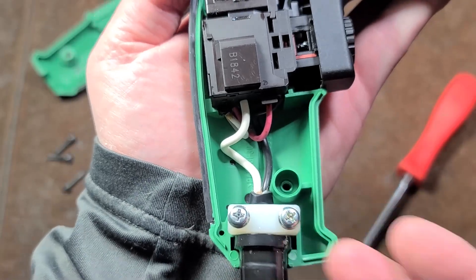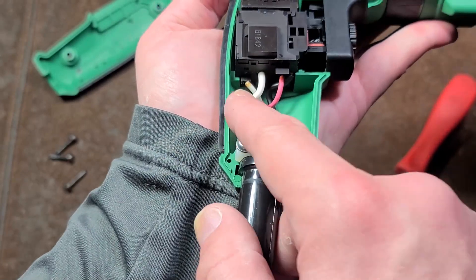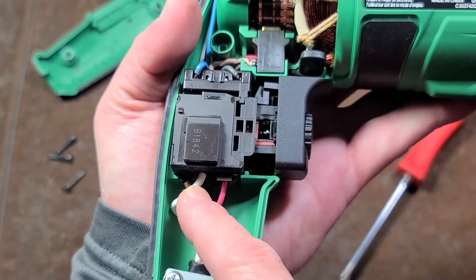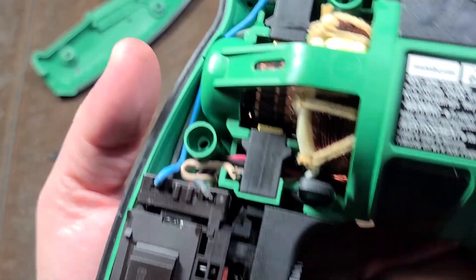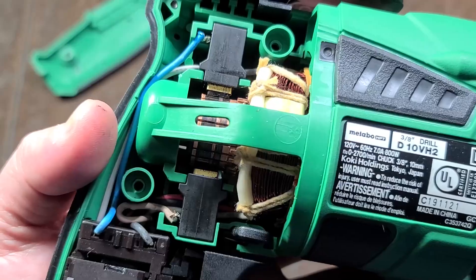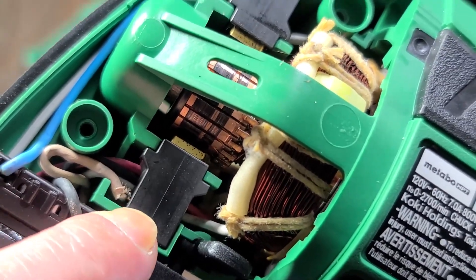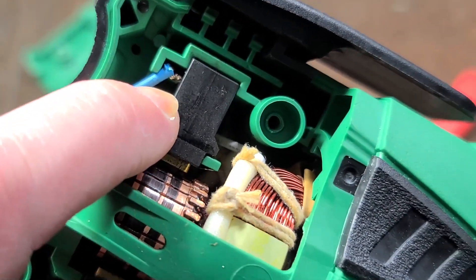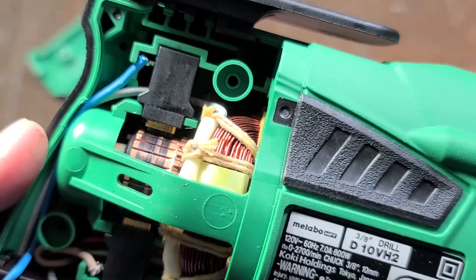Wiring seems to be okay in this unit. It isn't a proprietary power cord — pretty easy to replace. All you have is two wires and they're just in spring-loaded holes, which can be a hassle because you have to get a pick and shove it in next to the wire in order to get the wire to release, but it isn't too bad. Pretty easy to replace the brushes in this unit. Something interesting is the wires — they're just bare wires and then they're wrapped and soldered to the terminals on these brush guides. Ultimately, that should be more reliable just because there aren't any spring clips or anything that can get loose.